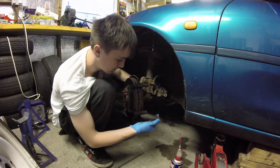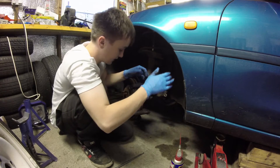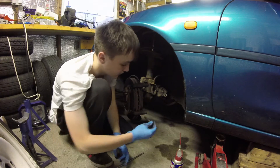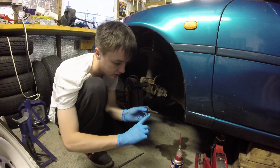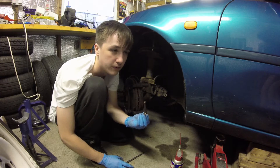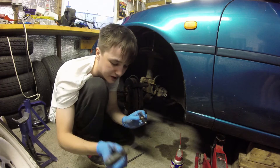Your slide pin should just slide on out — probably not as easy as that one just done. This one here is a little bit stiff but it does come out. It probably needs a good cleaning, but I don't think these are the problem — I think it's just the piston itself. As you can see, a slide pin is just very simple. If yours is bad, it'll be all gunked up, but this isn't. So it slides in and out quite nicely. You've also got this boot you want to clean out and put back in properly. If you've got gunk on here, just get a bit of sandpaper and sand it down until it's nice and clean. Then just reapply some kind of grease. Copper grease isn't actually good for brakes at all — you're not really meant to use it, but it's all we had. Because it starts to dry up and when it does, it clogs up, makes a mess, and just makes it more sticky.